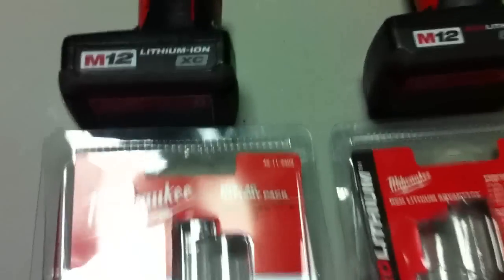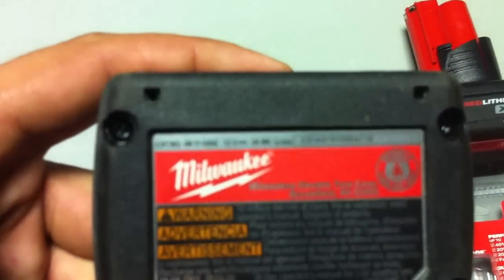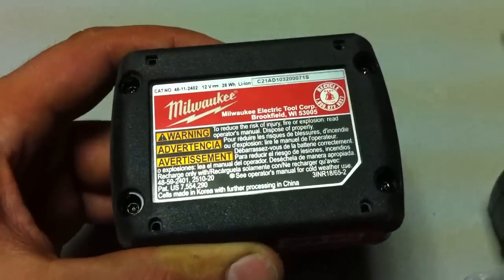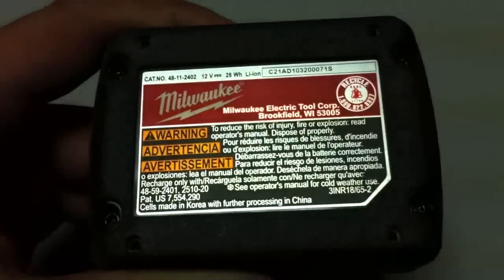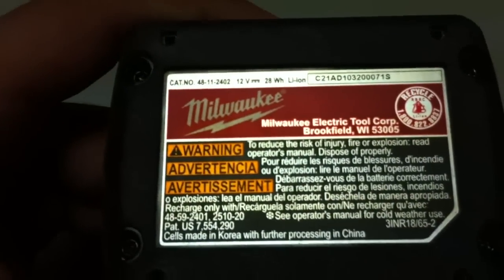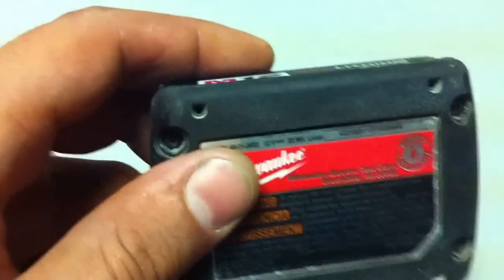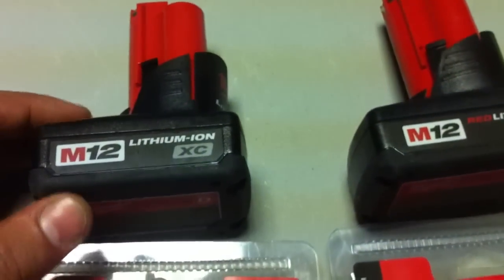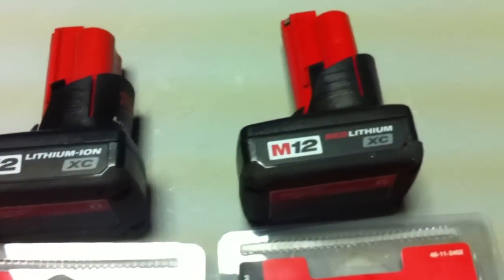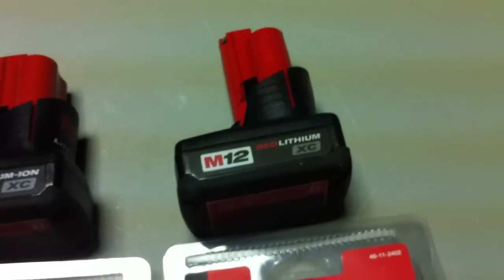But not only that, if you flip the battery upside down and look at the watt-hours of the battery pack, you can see this one says 28 watt-hours — that is the old pack — and the new one has 32 watt-hours. So they switched cells. They're still the 18650s, same size, still six of them. They just switched to a higher capacity cell, which I think is a Samsung, one and a half amp-hour. And I think they're the Q cells that push about 18 amps.